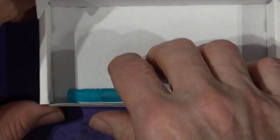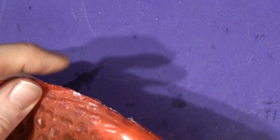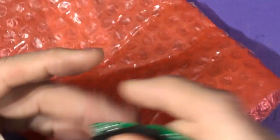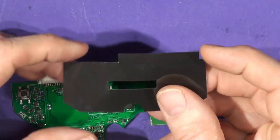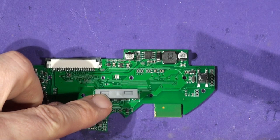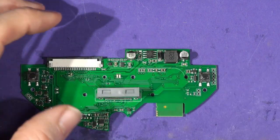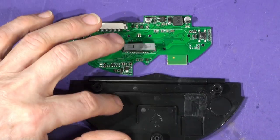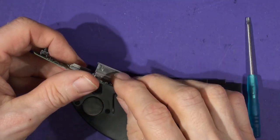All these boards are the same. You get the T8 screwdriver for undoing the screws in the base moulding. Take the BC7A carefully out of the bag — don't rip it out. Your BC7A may or may not have an overlay — you do not need to fit this overlay when fitting to a Sound Dock 2. If there's one in your kit, don't use it. The parts you need are three items: the moulding, the board, and the screwdriver.